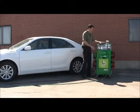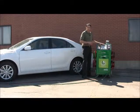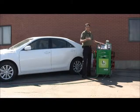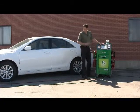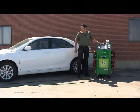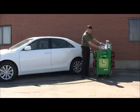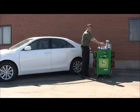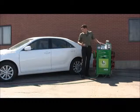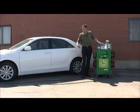Let's talk a little more about the machine. Back to the inflator — you'll also notice a top-off button. There are two times you'd use this. First, a vehicle comes in and they want their tires topped off — connect the hoses, hit the top-off button, takes a few seconds, and you're done. Also, let's say a vehicle has 32 psi in the front tires and 36 in the back. After you've gone through a complete two-cycle, turn it from fill to stop, disconnect the front, dial up the pressure to 36, put it back to fill, and hit the top-off button. In a matter of seconds, the front tires stay at 32 because they're disconnected, and the rear tires will go back up to 36.